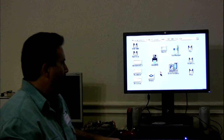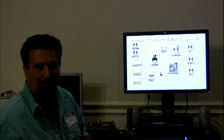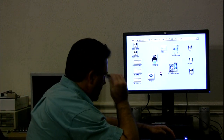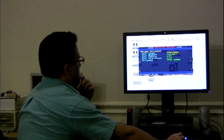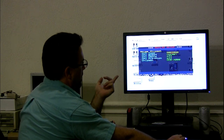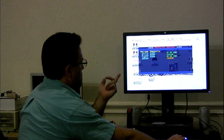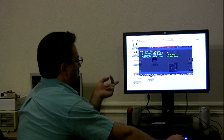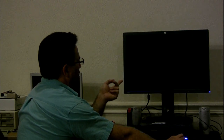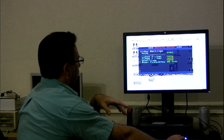Mike gave me a brand new version and it's buggy with hard drive stuff — sometimes it just hangs because they just enabled write capability for the first time. But just like everything else with the OSD, you can select your chipset — AGA, ECS — what processor, regular 020 or EC like in the 1200, your RAM, up to 48 megs of external memory or 8 megs of fast memory, how many floppy drives, floppy speed, and scanline frequency. It'll do SD versus HD for output.